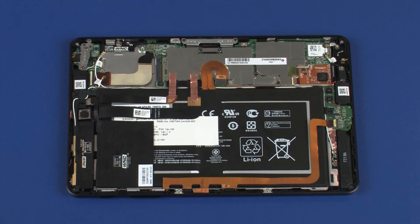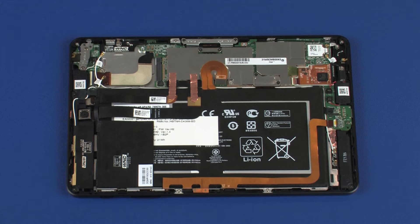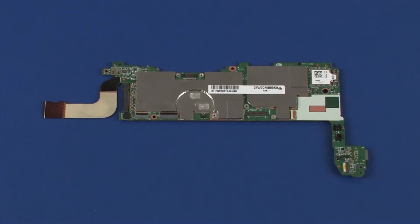Important! The audio board is paired with the system board. The audio board must be replaced every time the system board is replaced and is provided in the system board spare kit. When the audio board and system board are replaced together, reflashing of the TXE region in SPI ROM is not necessary. Before installing a new system board, remove the audio board ribbon cable from the old system board and install it on the new system board.